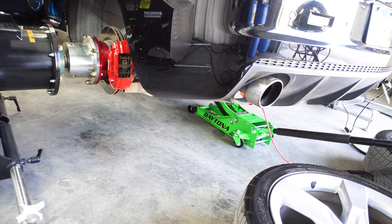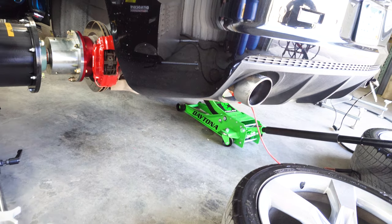Let's run it up with the charger and maybe we can make some pulls. As you guys can hear, I usually don't tune it to where it's a really choppy idle, but it has a pretty good chop to it — yet it's not so low that it wants to die when you pull up to a stoplight. I always hate that feeling. Some people like it super low so the chop's real hard, but that's just kind of my preference on how I set idle. If people want it more choppy, I can lower it.